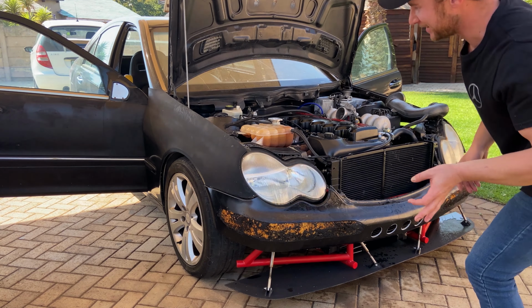This might also be leaking. Definitely have a few things to still iron out. And then on the gearbox, I thought that I filled it up, but apparently it wasn't enough fluid, so I had to add another liter of ATF in there. After I got that sorted, I had another go at moving the car.